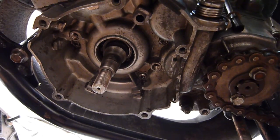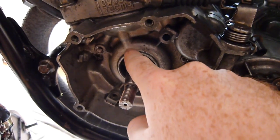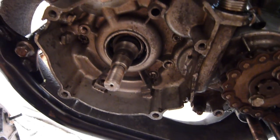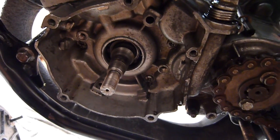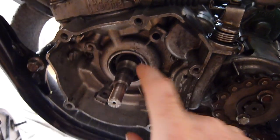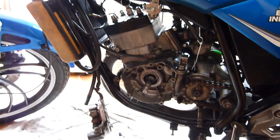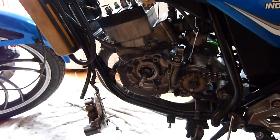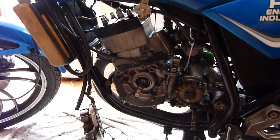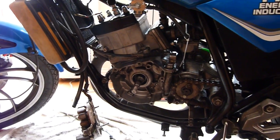The other concern with pushing the seal too far in was there wouldn't be as much lubrication going between the bearing and the crankcase because that hole was restricted. However, I've taken a good look at the bearing and it seems alright, so I think I've got away with it. I'm waiting for a new seal to come so I can press it in correctly, and hopefully that'll be the issue. If not, I'll be sitting here crying on the floor — but that's the joy of two-strokes. They're simpler to work on but a lot more finicky, because the slightest air leak anywhere and they just misbehave to no end.